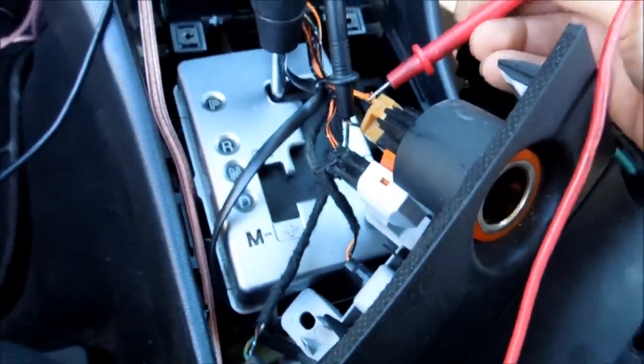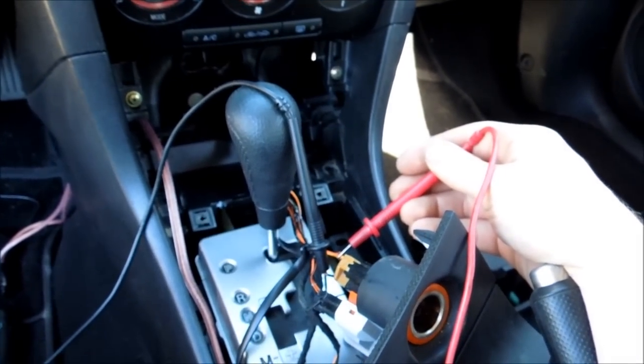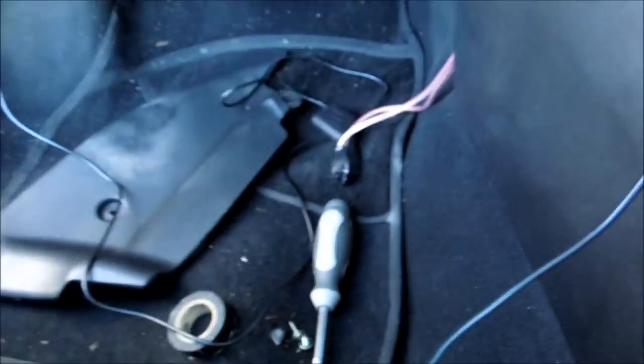The tip goes to the positive. After that, it'll make that live. After I get this all soldered up, I will show you exactly how it works. Also, as you can see, I've taped up the tip — make sure you do that. Make sure you tape your leads up nice and tight so that way they don't go anywhere, because you never want them to touch — that just blows a fuse.